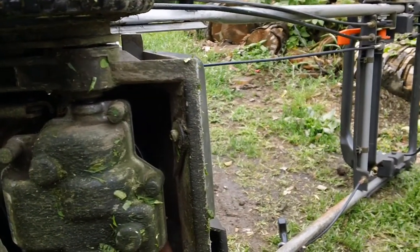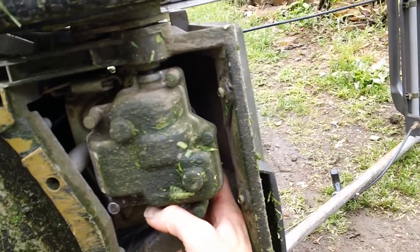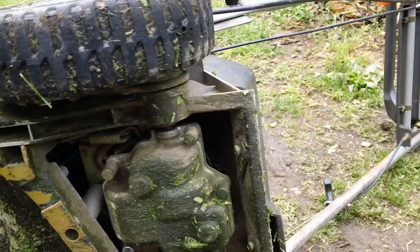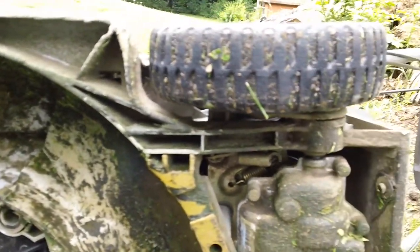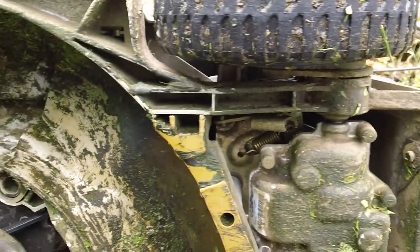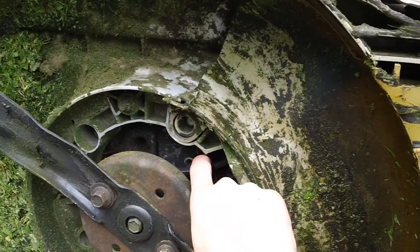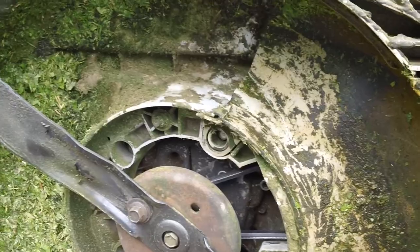You also have another big tensioner spring way in the back, where my fingers are, straight back through there. There's a real big spring in the back for that. So you have 2 tensioner springs, and one counteracts the other one. The main tensioner spring is what gives the belt nice and tight tension like it is right now, because whenever we originally took this thing off, the belt was basically loose as a goose.